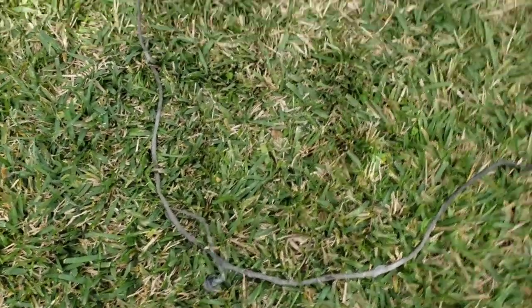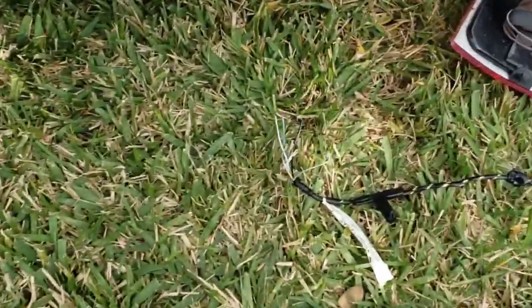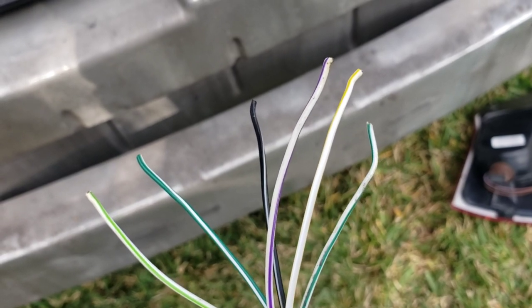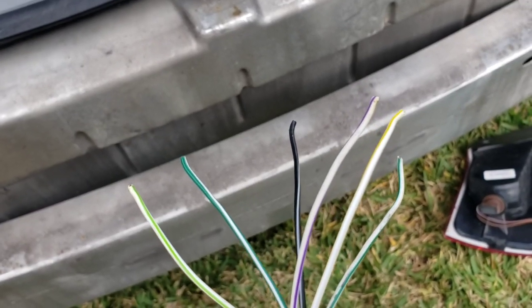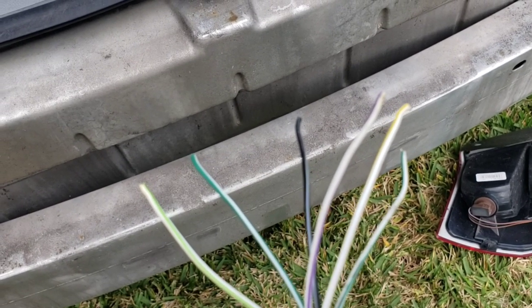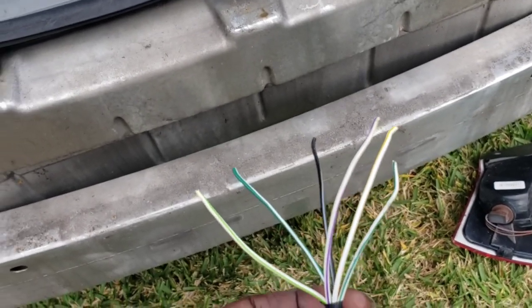This is the harness on the back light — the whole harness back light. We're doing the bumper with the smart access so I'm going to show y'all how to get that through too. These are your lights, your wires for all your lights in the back. You got six wires — I'm going to show you how to connect them to the new tail light harness. Your reverse light is in here, but all of these use the same ground. So you got park, signal, brake — park, signal, brake, reverse, and ground — all in this harness.